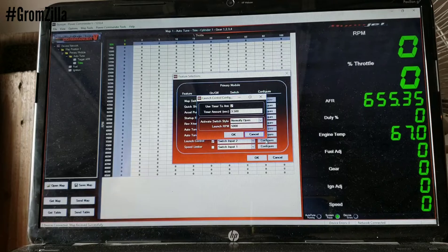There will be a link in the description below the video where I got that switch. You will have to fabricate your own bracket because I can't find anything like that. As far as I know, I'm the first one here on YouTube to design something like that. I've only seen one other bike in a forum that said they were able to successfully put launch control on the bike. But you cannot use the two wires coming off of your clutch — there is an electronic on/off on your clutch, but those wires have power going to them. You cannot just tap into them; if you unplug them the bike probably wouldn't work correctly. And if you tap into them, they have power going to them and it would ultimately end up messing up your Power Commander 5. So I wasn't willing to do that, and I came up with my own switch design.